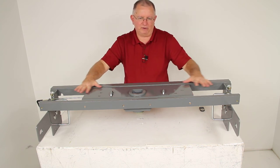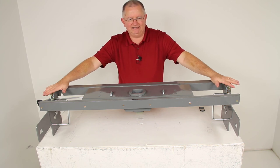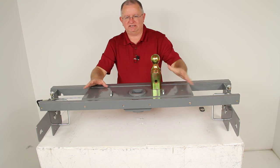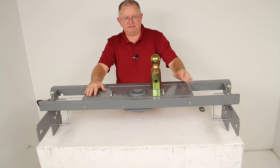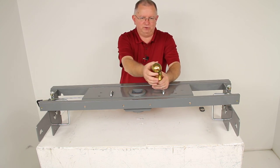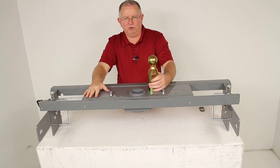This is all powder-coated steel, which is sturdy and corrosion resistant, and the part is made in the USA. The gross towing weight capacity is 30,000 pounds and the vertical load limit or pin weight capacity is 7,500 pounds. The gooseneck ball on this turnover ball is two and five-sixteenths inches in diameter. It comes with a limited lifetime warranty.